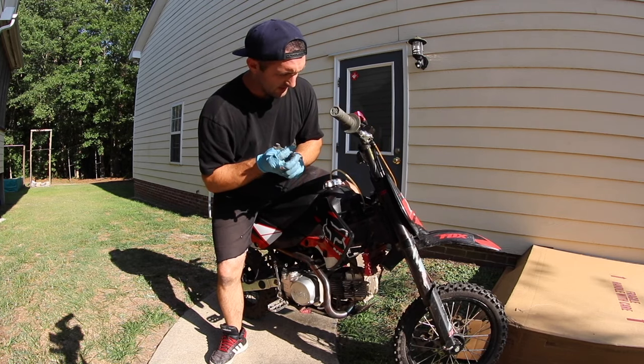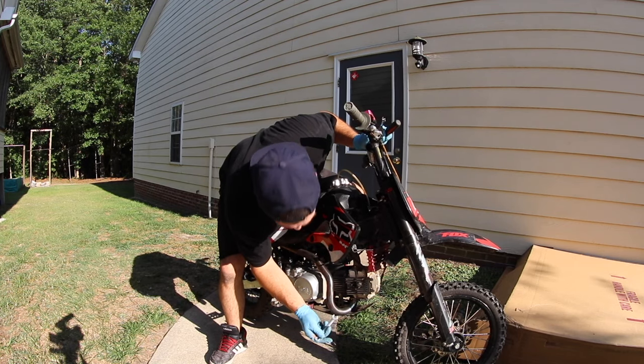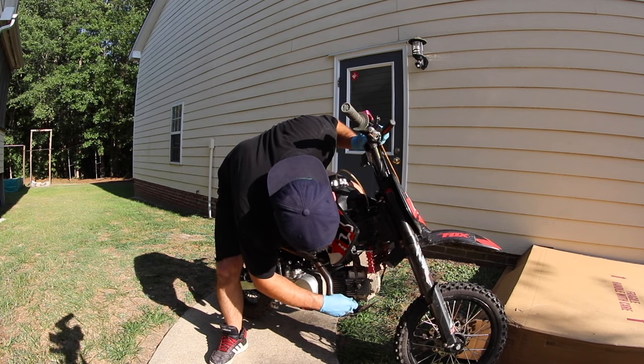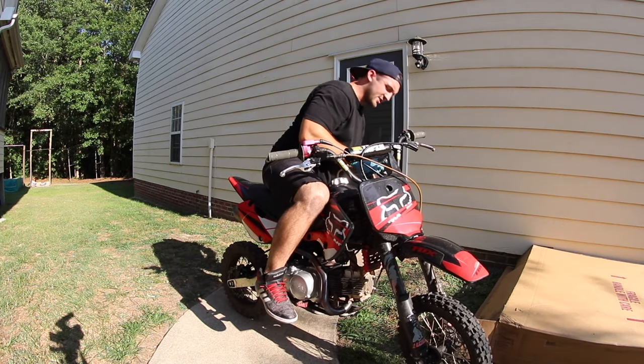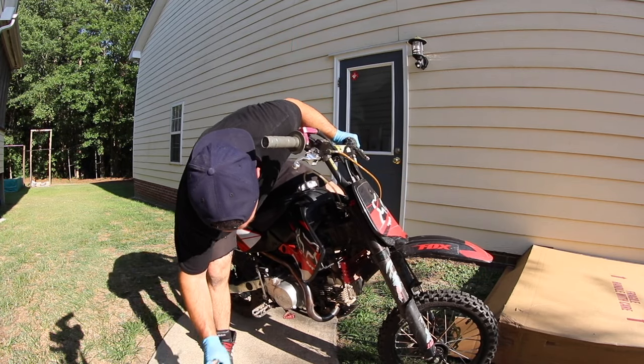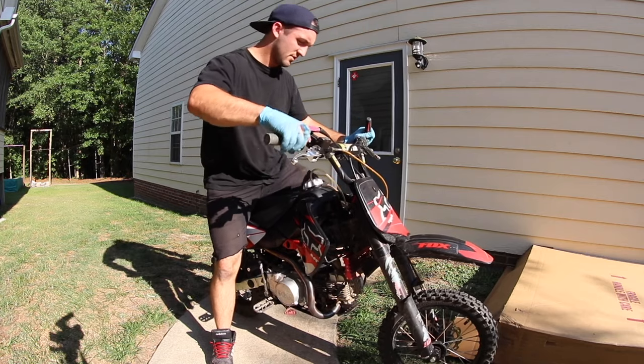And then the exhaust manifold, or whatever, there's one manifold, it's a little single runner. They're loose, so I'm gonna try to tighten these. All right, so I got the header a little tighter. I turned the idle down. Let's start it again and see if it sounds any better.